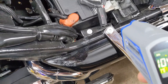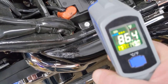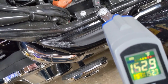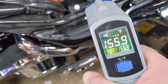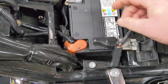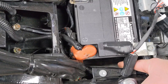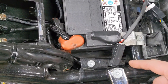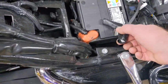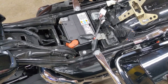These do get hot. They've been on for about a minute, minute and a half. In certain areas you're in the 80s, but down towards the bottom end of this thing you get close to around 150 degrees, so that should give you an idea — we definitely do not want these touching anything. I understand now what they mean about making sure they don't touch any wiring. I haven't figured out exactly how I'm going to attach them yet, but I need to find the safest place to mount these.